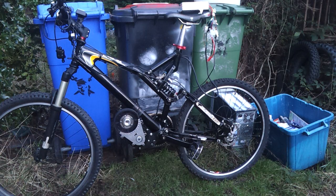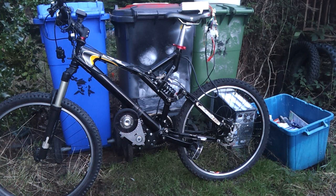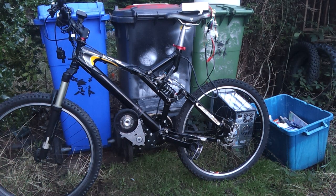So as a mid-drive, it's reasonably complicated — there are a lot of chains and pulleys and freewheels and things to line up and get right. Mid-drive builds tend to be a little bit like that, just a little bit more of an engineering project. A hub drive, by contrast — does it fit in the back triangle? Is there enough room? If there is, you put it in and you're away.